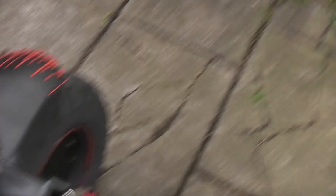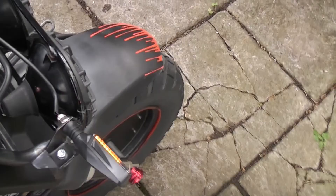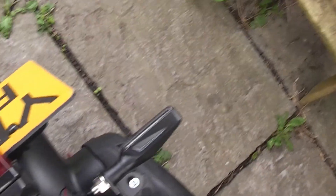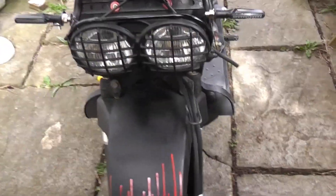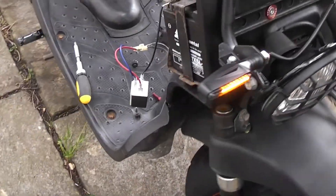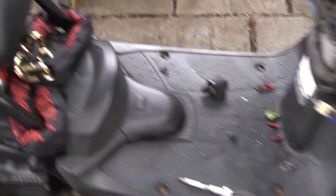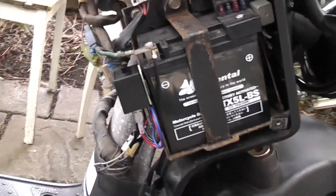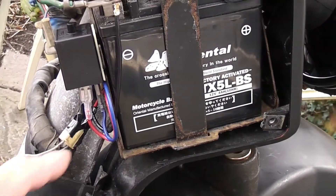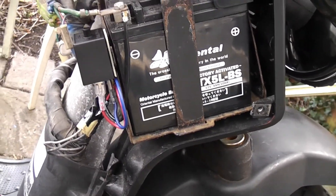It's already on. We'll go that way — that's working. And we'll go the other way — and it's working. That's it, all done. What I've got to do now is tidy it up, put the battery box case back on. This had a self-adhesive backing so I just cleaned up between there and stuck it where the old relay was. And I put a little bit of tape around the wires just in case — it's not actually touching anything, but you never know.